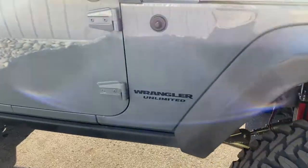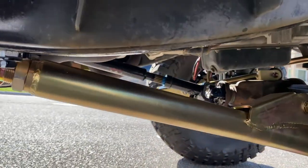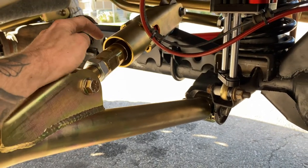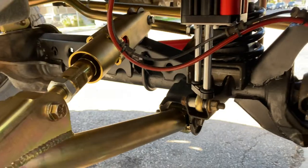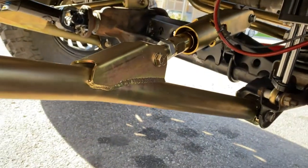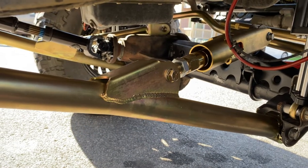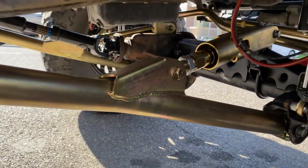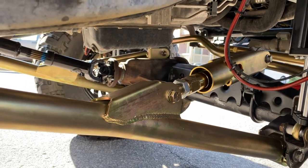Their long arm is a little different compared to most. One nice thing is you don't have to do any exhaust rework because it's a radius arm. The upper control arm looks a little funky — you loosen the jam nut, then loosen this part, and there's a little ring with another one about an inch and a half ahead of it. Loosening it gives you an off-road mode and an on-road mode. That spring inside loosens tension so when you're off-roading and it droops, the upper arm can open and close based on pressure. Radius arms are known for binding because the upper is directly connected to the lower — this solves that. Off-roading, you loosen the Lock and Load; back on the road, you tighten it up.